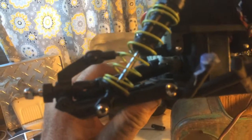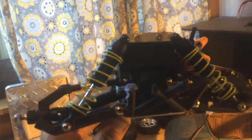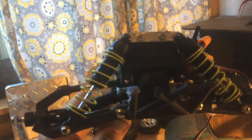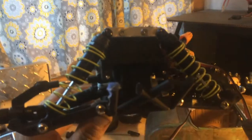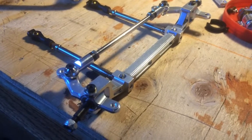When I narrowed the tracks - this is really easy - I took Rustler arms and put them up here a little bit higher, narrowed them in, narrowed the axles. All I did was cut them off, drill a hole through them, shorten them to whatever width I wanted, laid the interior shocks over the interior, and made new shock towers. The front shocks are not that big of a deal, pretty simple.